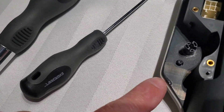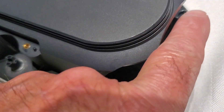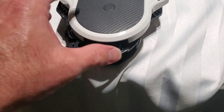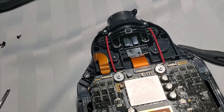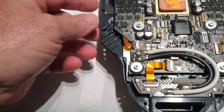Once you get the arms off, you'll see there are six screws — one there, one there, there, there, and then two inside of this lip here where the battery goes. Take those off. Once you take those screws out, you're going to lift the back of the case off the nose there and expose the motherboard and the body inside.